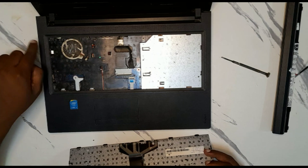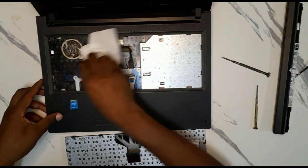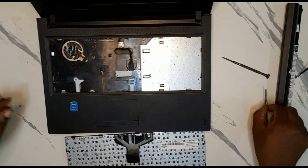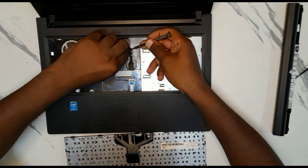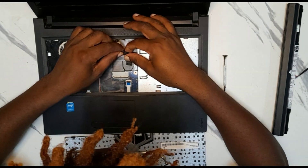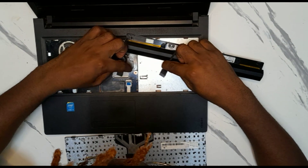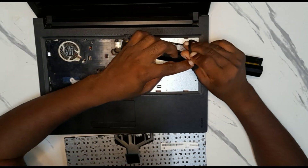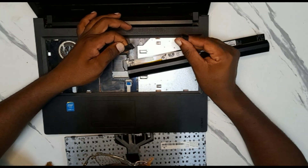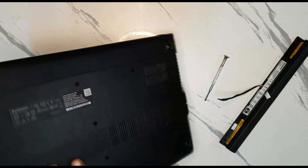You can try to clean up if there is some dust inside — use a tissue. Now we're gonna remove the battery connector and push it out like that. The new connector goes in like this — push it in. Notice there is an arrow showing the correct direction. We can fold it and then flip and remove the old battery.